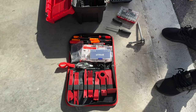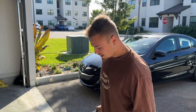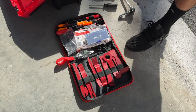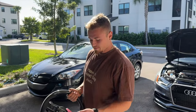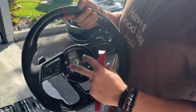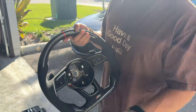What I have here is a trim kit to remove plastic trims without damaging anything — I got these at Harbor Freight, and this kit is awesome for working on stuff. I'll link it down in the description, it's about 20 bucks on Amazon. We're going to use a plastic pry tool to take out this piano black trim from here, pull this out, then take these buttons out, and then we can reach the paddle shifters.